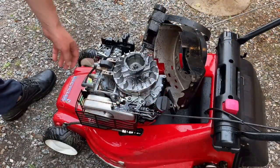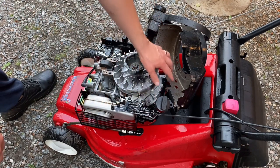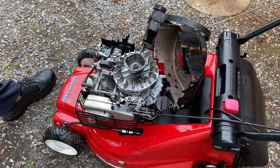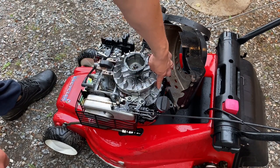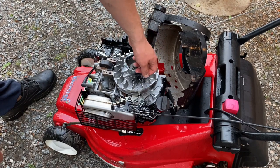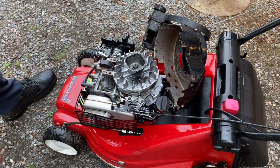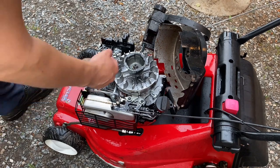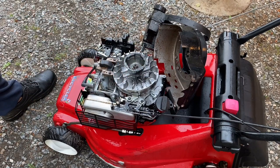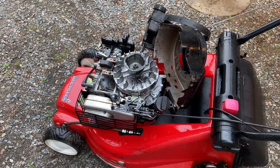Whenever you're doing something with a machine, I was cleaning this, so I would get water in here or in here. Make sure all the threads are clean. Use compressed air to blow them out, because if you thread a bolt down here, you might actually crack this metal, because you cannot compress the water that's in there. And it's the same thing if you're changing a head gasket on a car. You might have coolant going down into one of the head gasket bolts, the big bolts, and then you'll ruin it. So make sure everything is clean and that there's no water or oil in there.